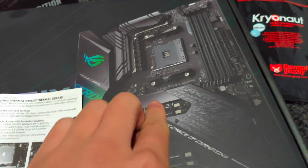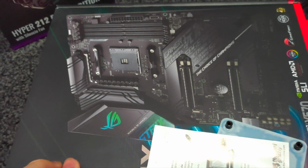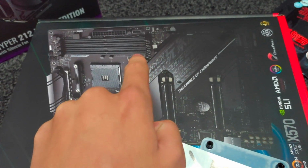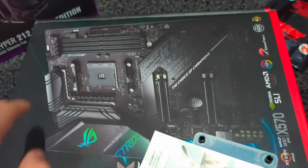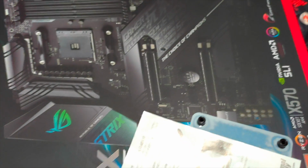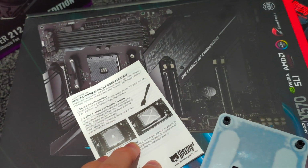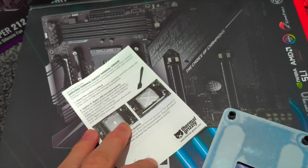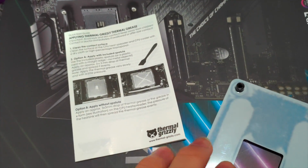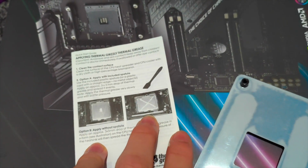After that, you have to tighten the four screws in the four directions. But you have to do this in a diagonal shape, so it will be 1, 3, 2, 4. Screws, you have to tighten as much as possible because you don't want to leave any space between the CPU cooler and the CPU. Otherwise, you would have a temperature of about 100 degrees when starting the computer, which is what I did wrong the first time.